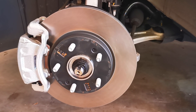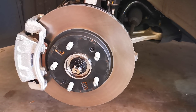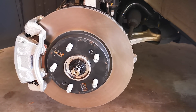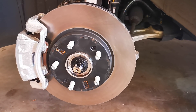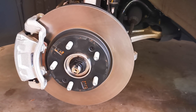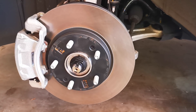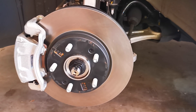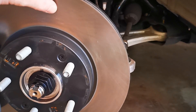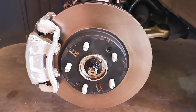There's the front brake pad, which has probably almost never been used because it's an EV, of course. It has regenerative braking. Even if you switch it off, it still uses the regen. If you put it in coast mode, it still uses the regen braking — unless you absolutely slam on the brakes, only then will the discs actually come on. I don't think there's any pad wear on that at all.